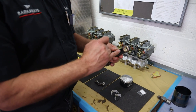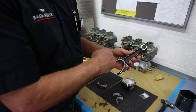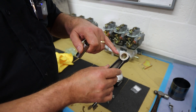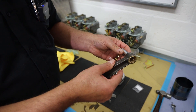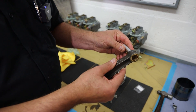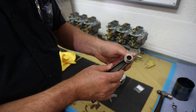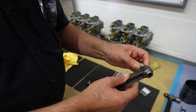Something else we've had done is the small ends, as I've spoken about before. We've got the big end, which is the crankshaft end, and the small end, which is the gudgeon pin end. What we've had done is these phosphor bronze bushes in here — they're all new bushes. You can see that's been made so it fits absolutely perfectly. Before we had too much slack either side, so now that's a perfect fit in there.